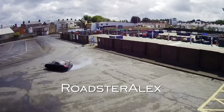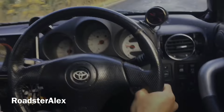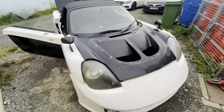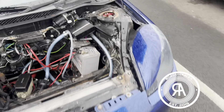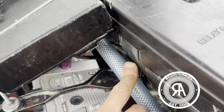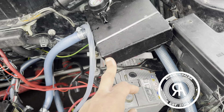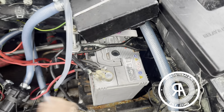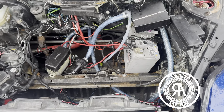In today's video I'm hoping to improve my water-to-air intercooler system. I think I made a mistake. Water flows that way and I take water from there to the top. I'm thinking that this side should go there and that side should go there, because then water goes into the top and goes to the bottom. I am getting some parts and going to swap this around.